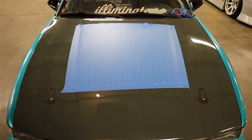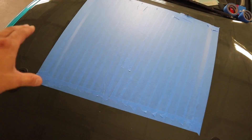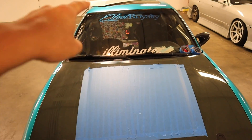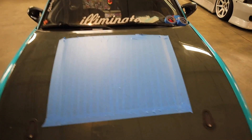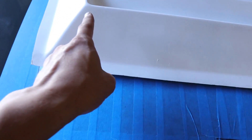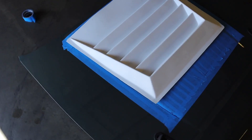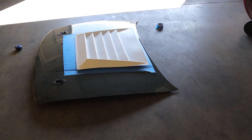Crossing my fingers, I hope it turns out nice. Got the hood covered up with tape. It's a little uneven, but that's not the actual size of the vent — I made it a little bit bigger so I got room to play with. I'm going to place the vent on top of the tape and make my measurements. I'm not going to cut while the hood's on the car; we're going to take it over there and cut it. Really nervous because I only have one hood. It took me a while to find this hood, so I guess it's time to make my marks. I made some adjustments — I pushed the vent back a little bit so the grooves are lining up, and I think it'll be a lot easier installing it.